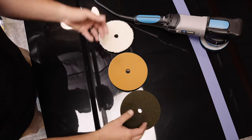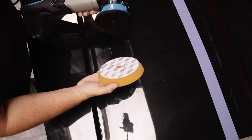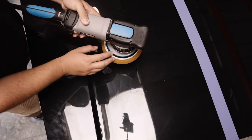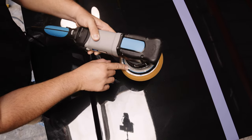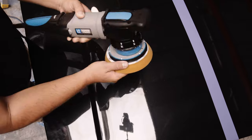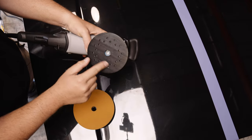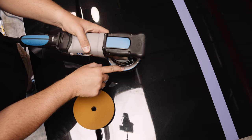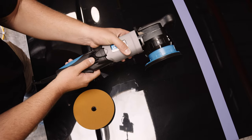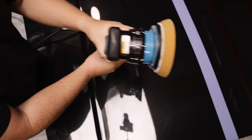With a rotary, just be aware it's a rotary. For this demo I'll use the medium pad for demonstrative purposes. It's worth noting that airflow is critical for this machine — it's pretty heavy even holding it by hand. The backing plate has holes on the back and vents at the top to redirect air and create airflow, all focused on keeping heat down.